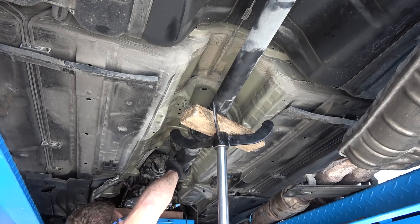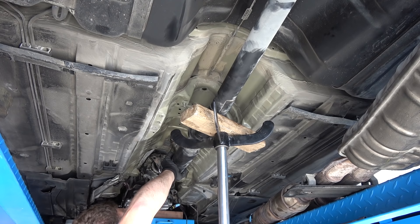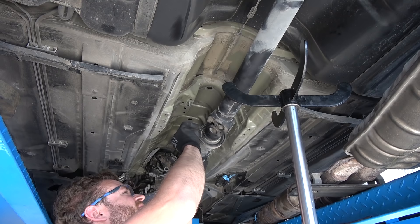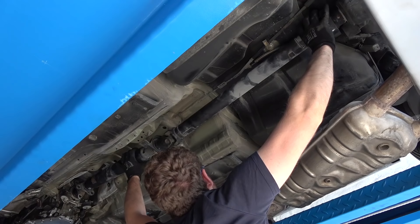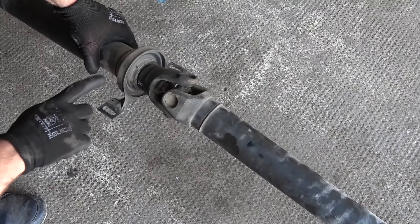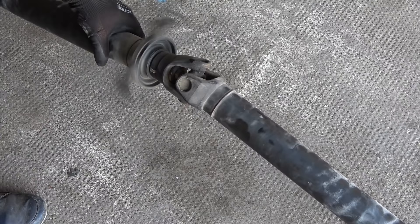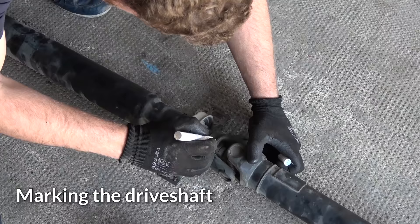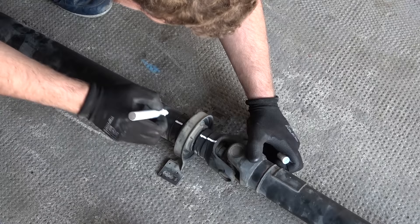There it is — the hardy scheibe — it's garbage. The bearing is shot as well. The car had a strange high-pitch sound at certain speeds while driving and I'm pretty sure I found the culprit. Not a very good noise, so I'm also replacing the center support bearing. I was planning to do this anyway since I had to remove the drive shaft.